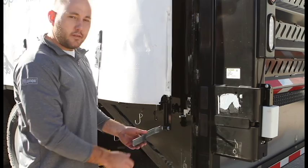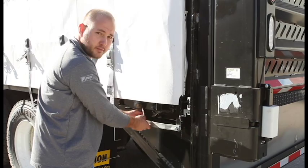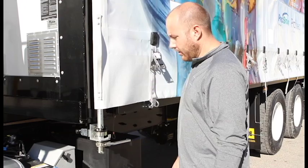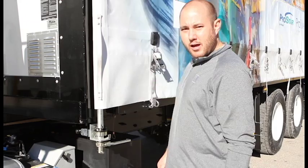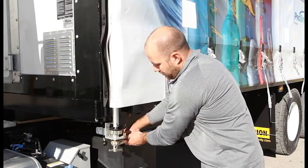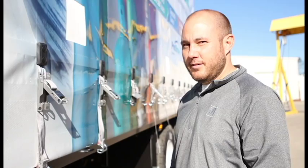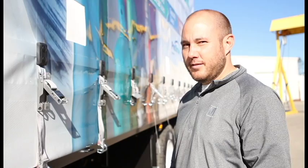Next, pivot the back side of the curtain side into the latch. Once it locks, rotate the handle and put the lanyard back into place. The back of the curtain side has now been secured. Now we need to ratchet the front side — flip the lever on the back side back down to re-engage the ratchet and begin ratcheting the curtain to the desired tension. Once it's in place, replace the lanyard on the handle. The final step is to attach the 11 ratchet straps on each side of the curtain side.